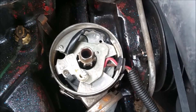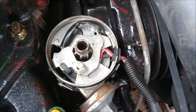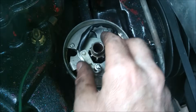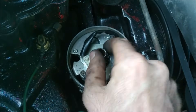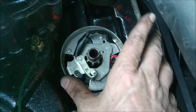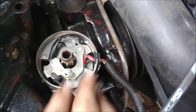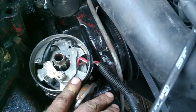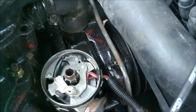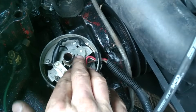Now we're going to try our luck tracking down the original part. They also make a Pertronix kit that will slip over here - a new piece goes in with its own built-in module. The Prestolite part number would be 1483, or 1483A if you have the points distributor.